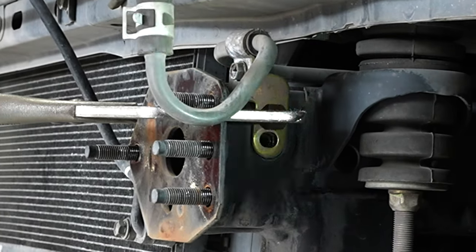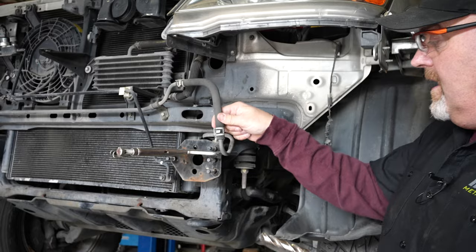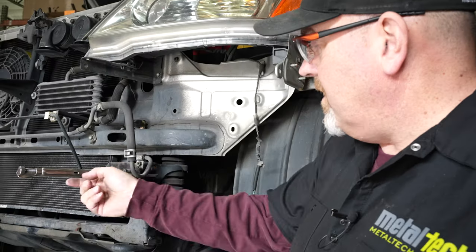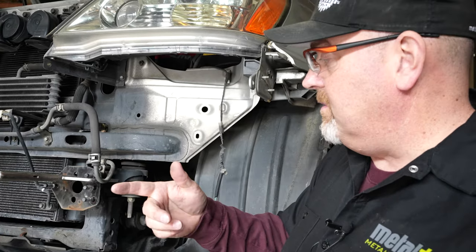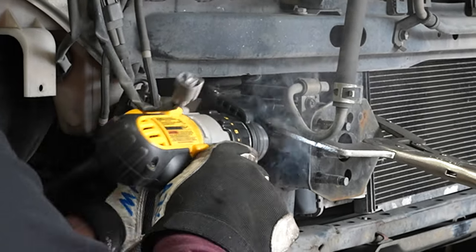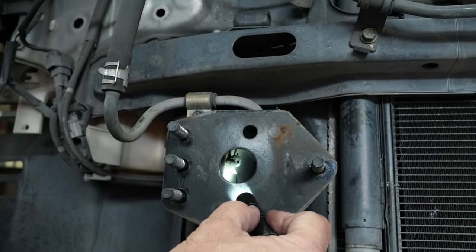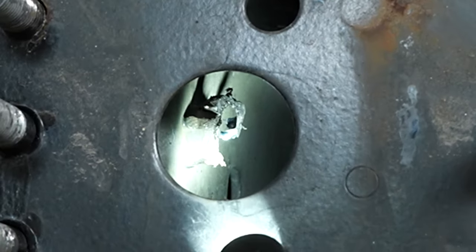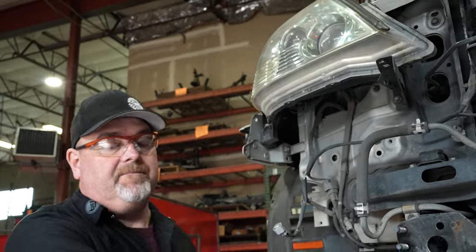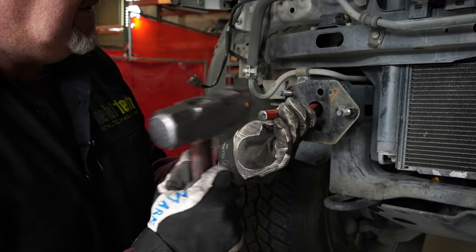I'm going to be drilling this hole out, and this power steering cooling line has a little bracket that goes there — we're going to drill the bracket out too. I threw a clamp on there so I can drill them both at the same time. You can also take the bracket off and drill it on a table if you wish. I'll reach inside with a cold chisel — there's a frame nut in there that we just drilled out and we're going to remove it with the cold chisel, just knock it off. That leaves a clean space for us to put our half-inch bolt through with washer and nut inside the frame.